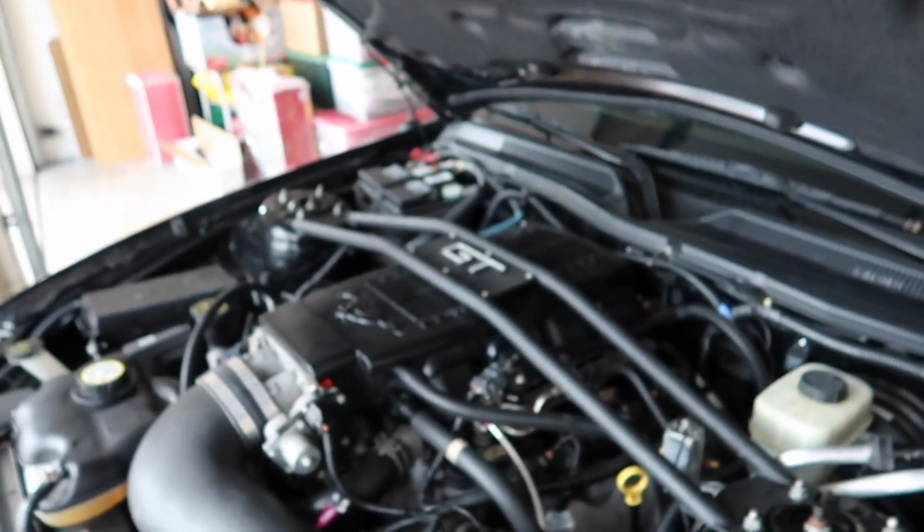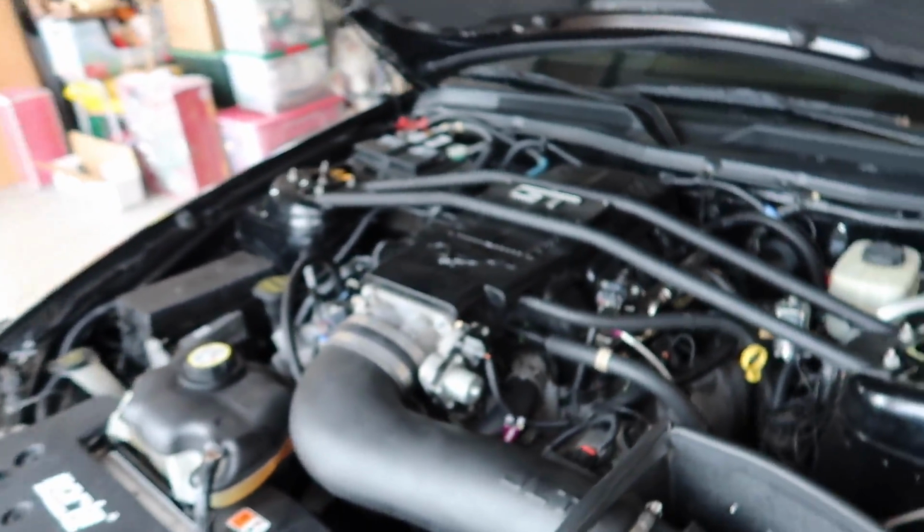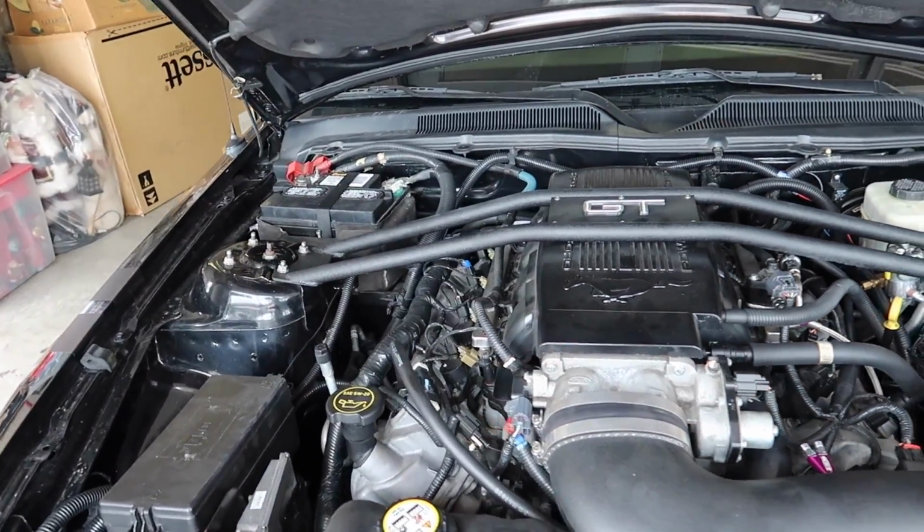And I did research on his camshafts and I looked through it all, and I did find out that those camshafts, although they are a direct replacement from the company that they listed, if you scroll all the way to the bottom, they actually highly recommend to change out your springs and to change out the phaser limiter kit. And so they actually highly recommend it.